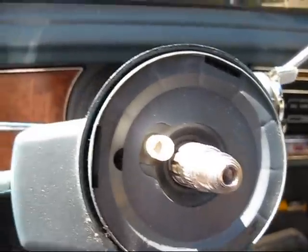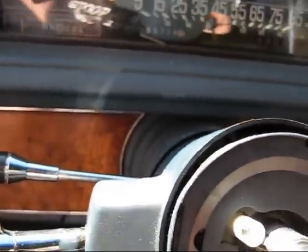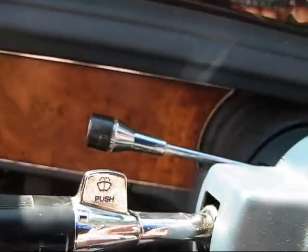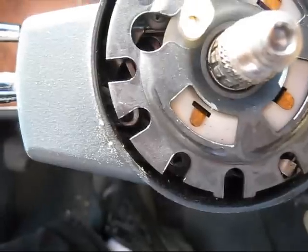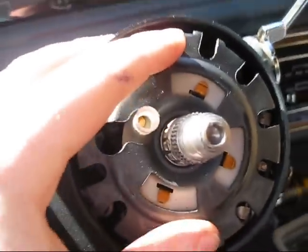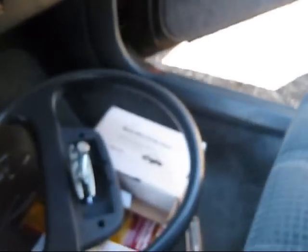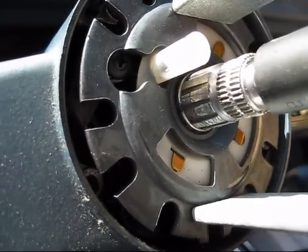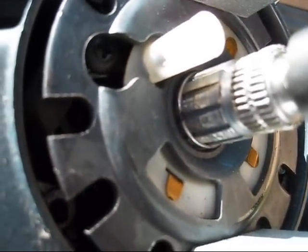Now I've got this plastic cover to contend with, and it just pops off with a screwdriver. There we go. Now you can see the locking plate. To get this off, there's a little clip down here and you've got to push the locking plate down. That's what we've got that tool there for, so let's get that set up. With the lock plate compressor in place, now you can see we can get at that little ring there. So we'll take that off now.